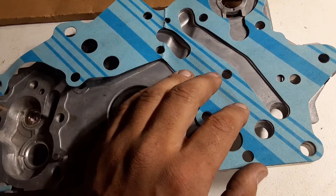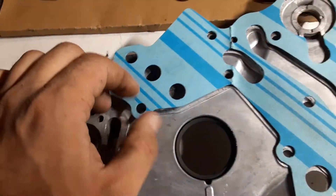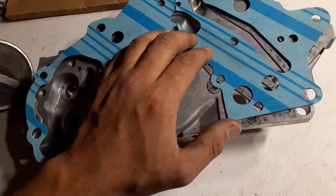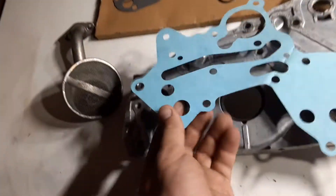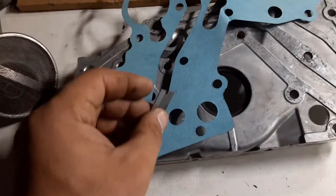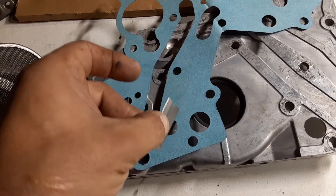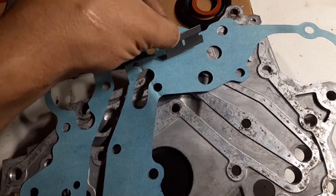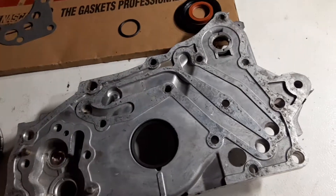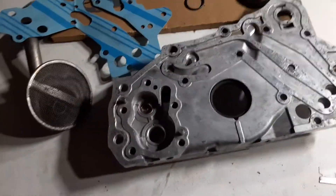When you're gasket matching this, you want to put bolts through all the little holes and put fasteners or nuts on the other side to hold the gasket flush, so that you can mark it or press it down. When you flip it over, you'll have a mark of where to cut. Basically you're going to cut it from here to this point, and you also join this section here. What that does is you'll no longer have the thickness of whatever this gasket material is—you'll have gained that much volume for the oil channel.